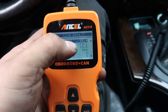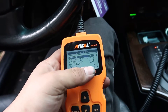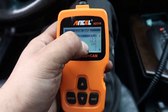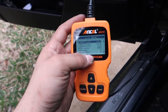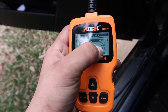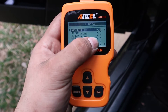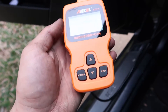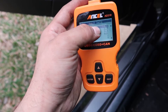Negative 15, positive 15 - it's looking like it's going to work itself out after a while. I think we fixed the issue, it's looking pretty promising. I just need to drive it for a while and see what the numbers look like. Update: it's running so much better. The closer to zero percent the fuel trims are, the better - right now it's at 0.8 short-term and 0.8 long-term, and now it's at zero on the short-term. It's confirmed fixed, and that's always cool.